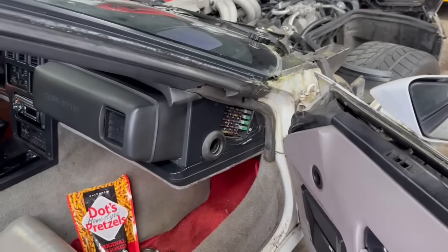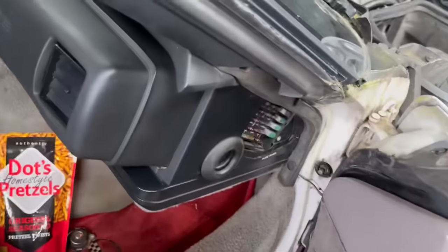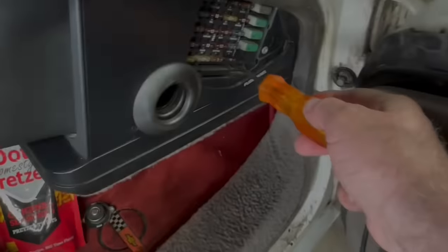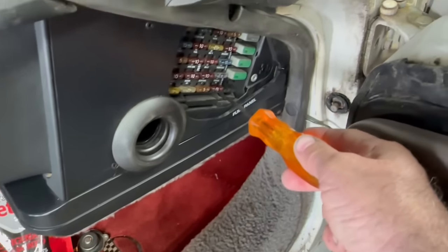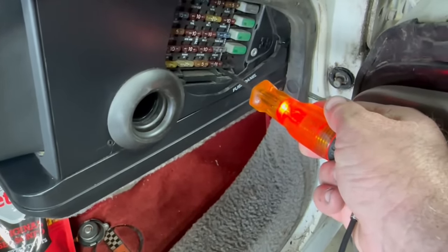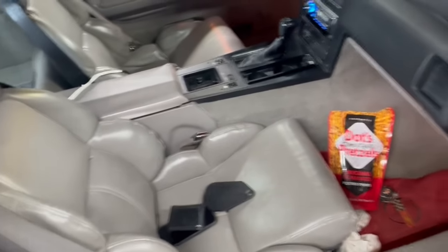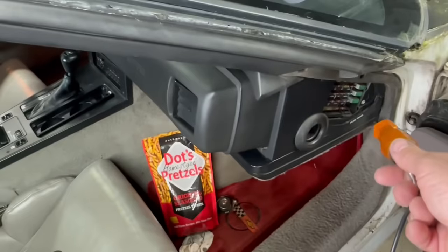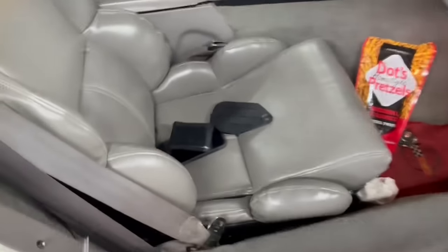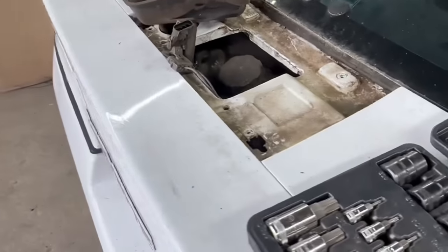Turns out this is the fuse panel on this side — the bottom fuse is a 10-amp that goes to the fuel pump. If you put the ground on here and your test light over here, this is the fuel pump relay. With the key on, it does not come on at all — not even for priming. But when you turn the motor over while cranking, you can see it come on. The ECU is not sending the two-second prime signal we expected. We were confused, then tried to crank it and it was fine — so we do have a bad fuel pump. We hot-wired it to confirm.